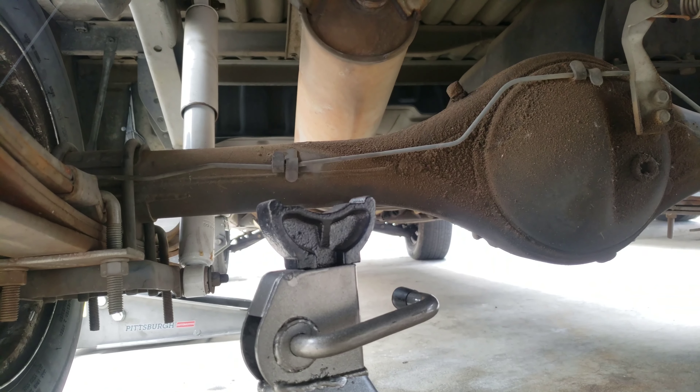Same process on the other side — the jack under the diff, the stand over there at the front of the vehicle. This one's a little bit easier. Just start bolting off, put it back on. That's it — as long as you have the stand you're secured, nothing's gonna fall on you. That's how you replace the rear shocks on your Nissan pickup, or most pickups that have these leaf springs. Pretty simple! Thanks guys — like and subscribe, let us know what you think, keep up the comments and any suggestions. Have a good day, peace.